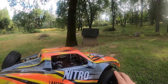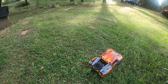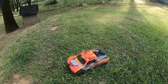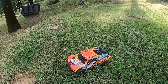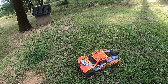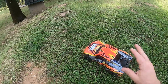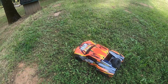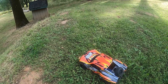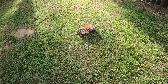It's not geared very high, and the mesh is really good. It might just need oil in the bearings on that motor. I'm gonna call it — it's nice and fast. Next thing I'll do is put the 80-amp ESC in it, then eventually gear it up a couple of teeth and put a proper fan on that motor. I had this motor laying around and it fit perfect, so I figured might as well. I think this thing should have come with a 3300kV motor on 3S. This motor with a little gearing — it'll be perfect. All right guys, peace.